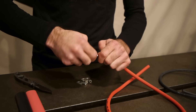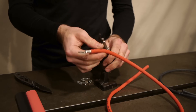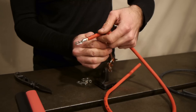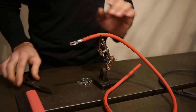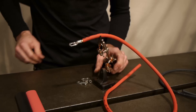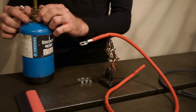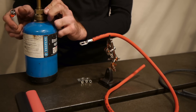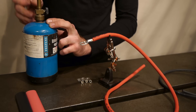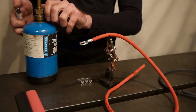If you force the terminal on there, it causes the copper to bulge out just a little bit, and that holds it in position while you make the solder joint. I'm also going to use a clamp to hold this in place because I'm going to need two hands — one for the torch and one for the solder. If you don't have a clamp like this, you can use a bench vice, a vice grip, or several other things. You just need to have it stay in place and maintain position while you're working. With most soldering you've done in the past, you may have used a soldering iron, but that won't have enough power or heat for this application because this is a heavy wire and a very heavy terminal. So we're going to use a plumber's propane torch, available at any Home Depot or home improvement center.